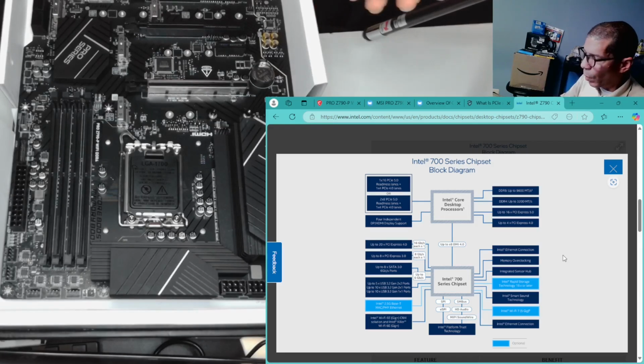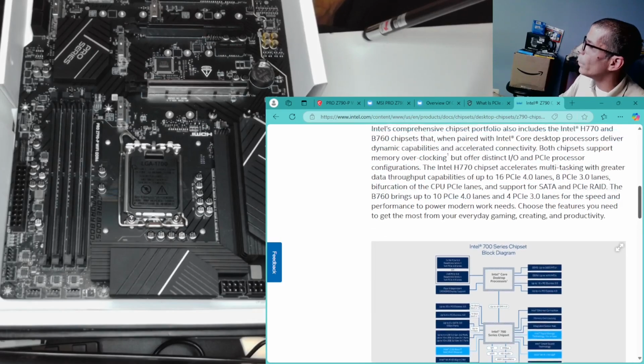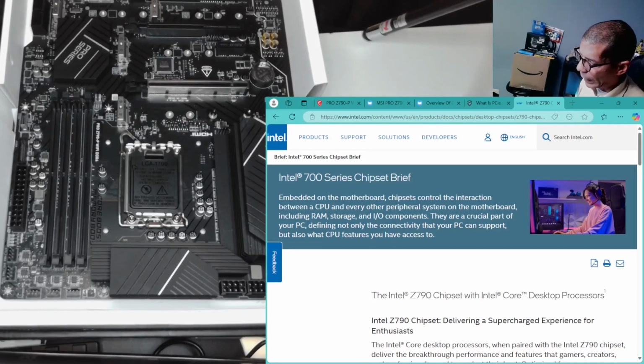So if you encounter another motherboard with a different chipset, totally outside the 700 family, then hey, you might be losing or gaining other capabilities. So be familiar with what chipset you have, because that can tell you not only the capabilities of the motherboard, but also, when you start hunting for drivers, what to look for in the event that you don't have a provided CD with it. One of the main things to concentrate on is, hey, I need to get the drivers for that particular chipset.